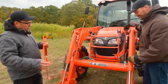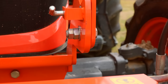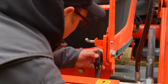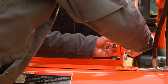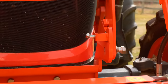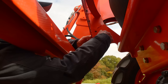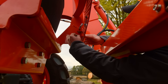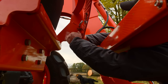On this design, we're going to start by loosening and removing those two larger bolts at the pivot point, since this guard utilizes those bolts as one of its mounting locations. What I like to do is leave one bolt sticking out and the other one still engaged but somewhat flush, so you can put the guard in there. Then we replace the washer on each side followed by the two nuts — for now just getting the lower part located so we can mount the upper locations.